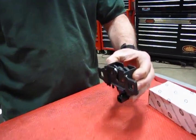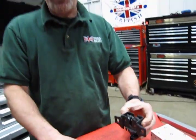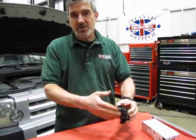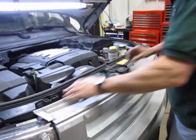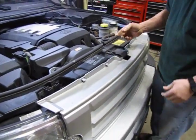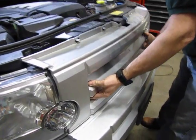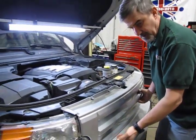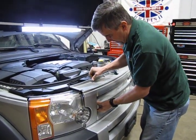Before changing the switch over, take a good look. If you've got a lot of rust build-up in that latch, it probably wouldn't be a bad idea to change both the switch and the latch. So we have an LR3 here and we're going to show you how to change this over. On the LR3 you've got four push tabs along the top of the grille. A Sport is going to be similar, except on the LR3 you have squeeze tabs on the bottom as well, whereas on a Sport there are two tabs that run down into rubber spigots on the bumper — those you just lift up and pull out. On the LR3s you need to release this lower switch.